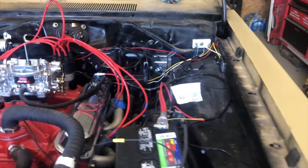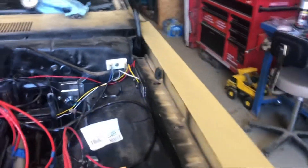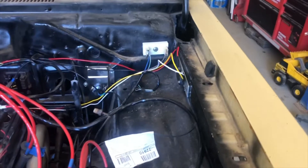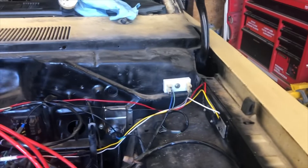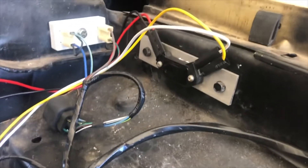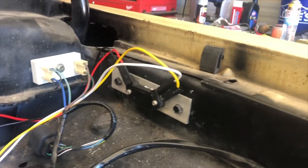All right guys, we're gonna go back into action mode. Let me explain what I did. I went out and purchased an actual ECU that goes on this car, and it didn't work — there was no power coming out of it whenever it was grounded, and I had no power at my distributor wires with everything hooked up. So we knew it wasn't gonna work. There was no sense continuing on with it. So I went out and got a GM part — we got an HEI ignition system now.